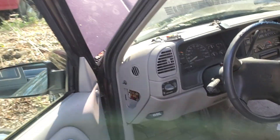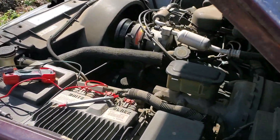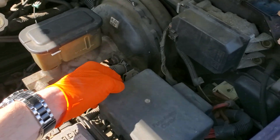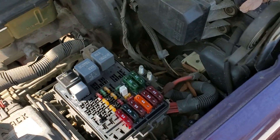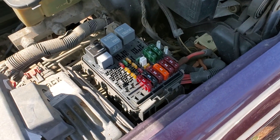The parent fuse is going to be under the hood. So you pop this cover off — there's a tab you push in here as well as right here. This 50 amp fuse feeds both of those fuses in addition to providing power for the courtesy lights.